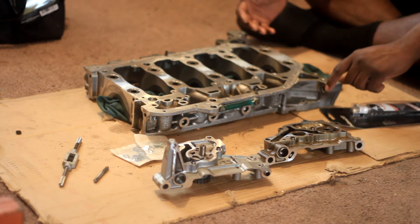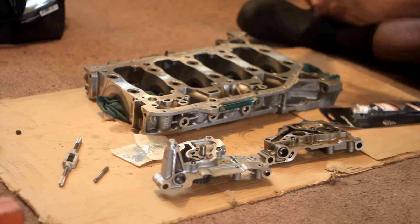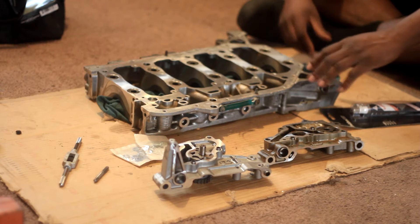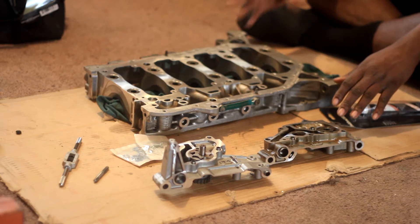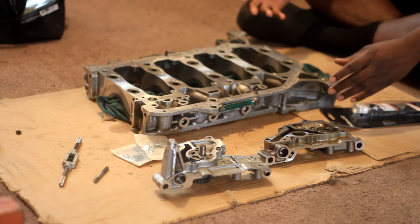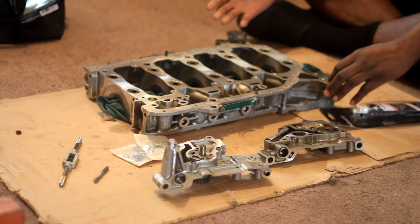The reason why I'm doing this again is because the Type-S oil pump is way lighter — a more simple setup. If anything happens, it's easy for me to go into an engine and take things off. It's lighter, it spins slower, so cavitation is reduced, causing less air being sucked in, pitting the gears and rotors, allowing me to rev higher.